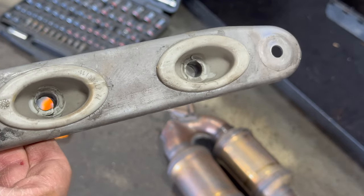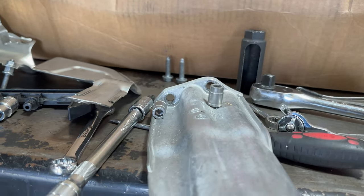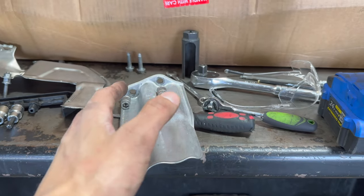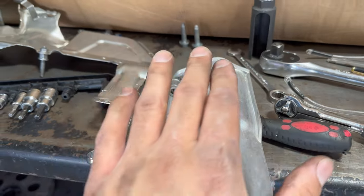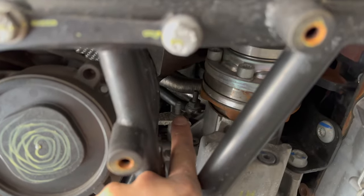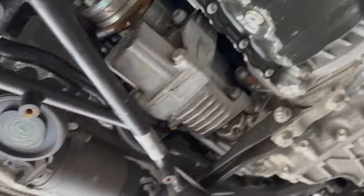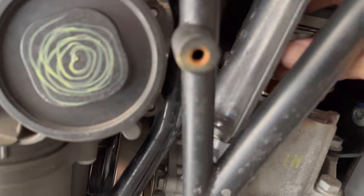This one is going to be a pain for a lot of you. The heat shields in general are kind of really crappy. You've got two 8mm bolts — this shields the axle from heat. If you forgot your long 8mm on a socket, a T50 fits in there perfectly and they're not on there tight. I'll show you exactly where this sits — one and two. If you've done this on a MK7 it's literally the same exact thing.